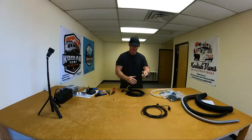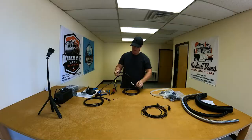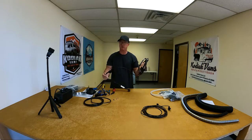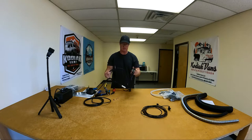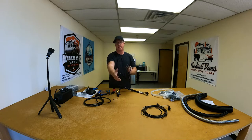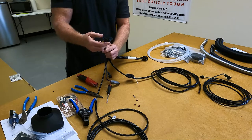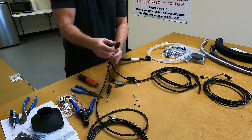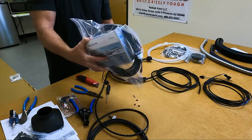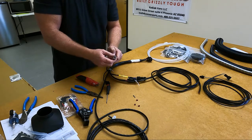On this other stuff here, you have your main cable with two really long other wires. You can leave this clamp on here so they don't get out of control. This is the one wire that has the fuse box right here — the fuse box is connected to a pretty long wire. This is actually going to go underneath the compartment between the driver and passenger seat as well. The pieces that go on the end of this are too large to get through that cavity hiding underneath both seats, so we'll leave that one until later. You have another short one here — it says 'do not bend' — this is a diagnostics port; you don't need that.